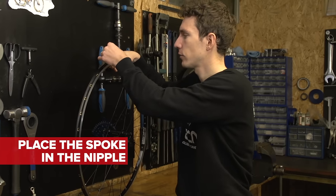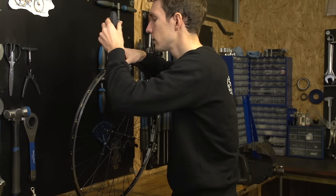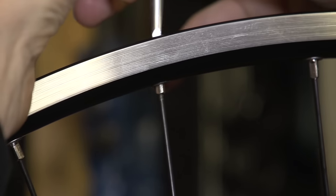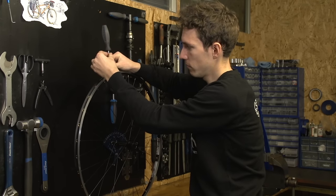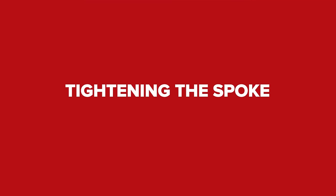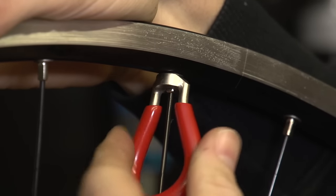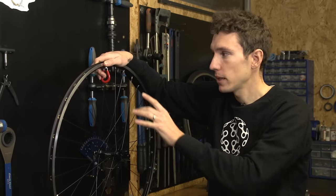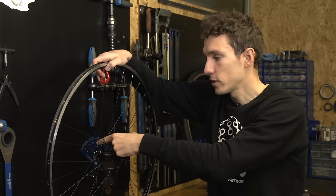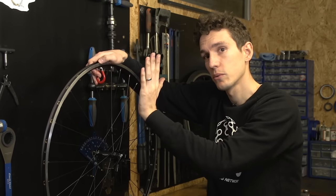Once that's in place, you just carefully unthread it, and then use your flat-bladed screwdriver to start tightening the nipple onto the spoke, until there's enough nipple through the rim for you to attach a spoke key. Now it's just a case of tightening the spoke to the right tension and truing the wheel. The key thing to remember is that as you tighten the spoke, it'll pull the rim over to the side of the wheel that the spoke originates from — so in this case, the spoke comes from that side of the hub, so it pulls the wheel in that direction.